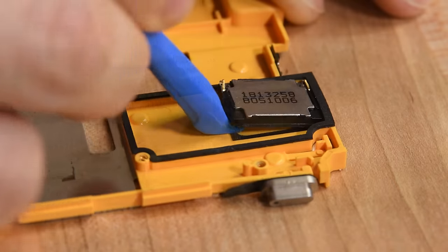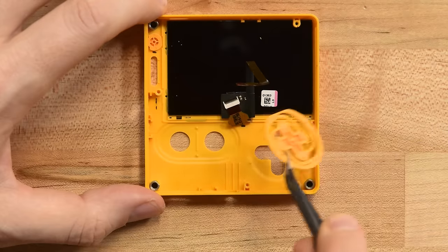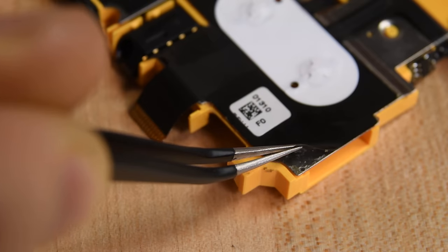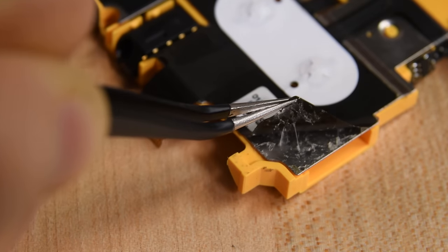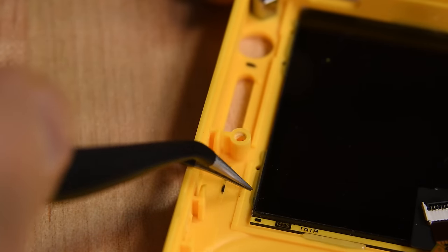The mono speaker is held down with adhesive — easy to yank out, but a little tricky to re-adhere. The front of the Playdate has button covers that press down on contact pads on a flexible printed circuit glued to the mid-frame, and we don't really recommend messing with them. Finally, the screen is glued to the front and it doesn't seem like you can separate it without damaging it.